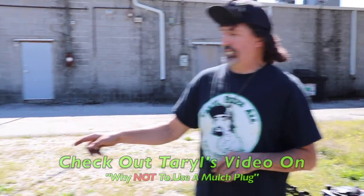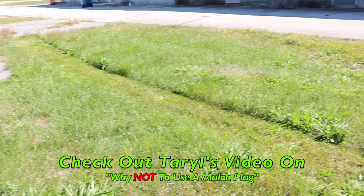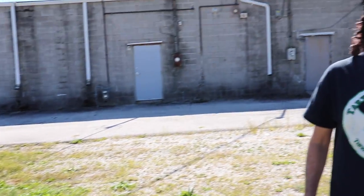Maybe you do know, but you're not supposed to mulch grass that deep. So you heard it really pulling itself down. The way mulching works is you shouldn't be cutting off more than 1 inch of the grass at a time in order for it to work properly. So what I just did there wasn't right. But I just wanted to show you on camera.